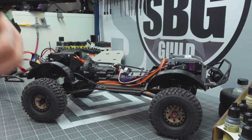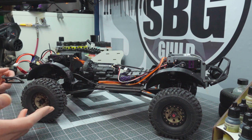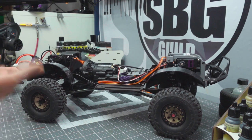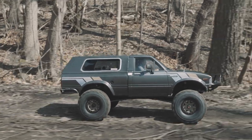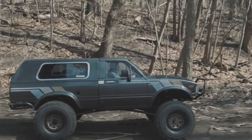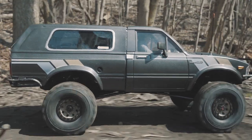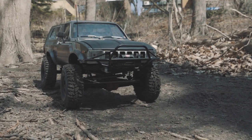Because you can change all of these parameters, you can dial in how much or how little dampening there is based on how much multiplier there is or how much spring rate — you can change all of those things to give it more or less suspension movement. It is infinitely customizable. If you've got a big heavy Chevy body and you really want to see it rock around, you can set it up that way. If you've got something lighter like this Hilux, you can set it up to be a lighter sort of suspension. It's a pretty much set-it-and-forget-it style system — once you make the adjustments on your analog inputs, it remembers them and there's no need to reset the controller each time. It just works automatically.